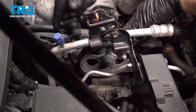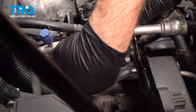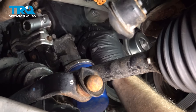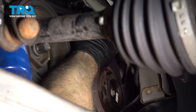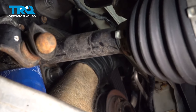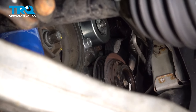On the upper belt, put a little clip on here to hold the belt on the upper portion so we can work down below and continue routing. The belt comes down, runs around the harmonic balancer, around the AC compressor, to the tensioner, and then up to the alternator. Compress the tensioner and pull the belt up and over.